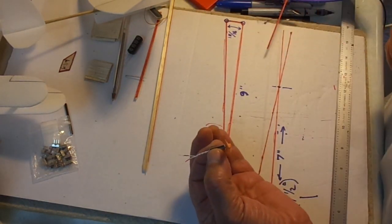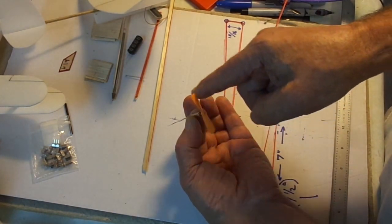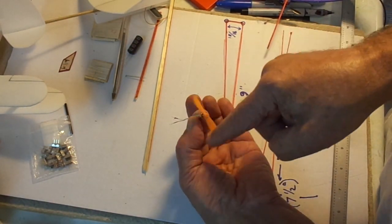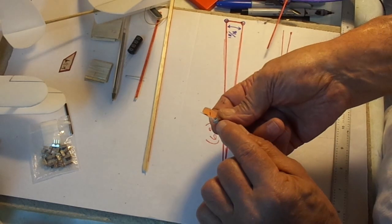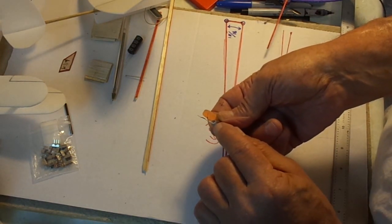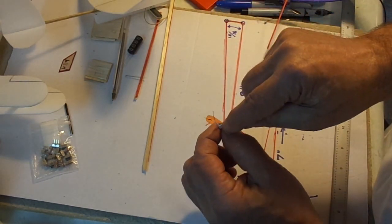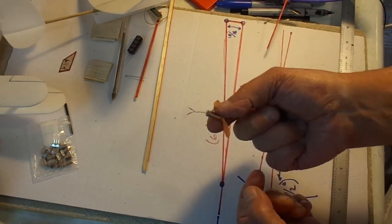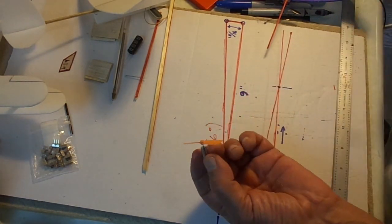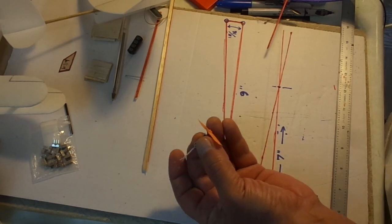Okay, so if you have a motor that turns this way, standard rotation, it has a gray back brush plate on it. The ones that are preferred to turn the other way have a white brush plate on the back. As far as the Banggood so-called upgrade 615s that we're using for this.